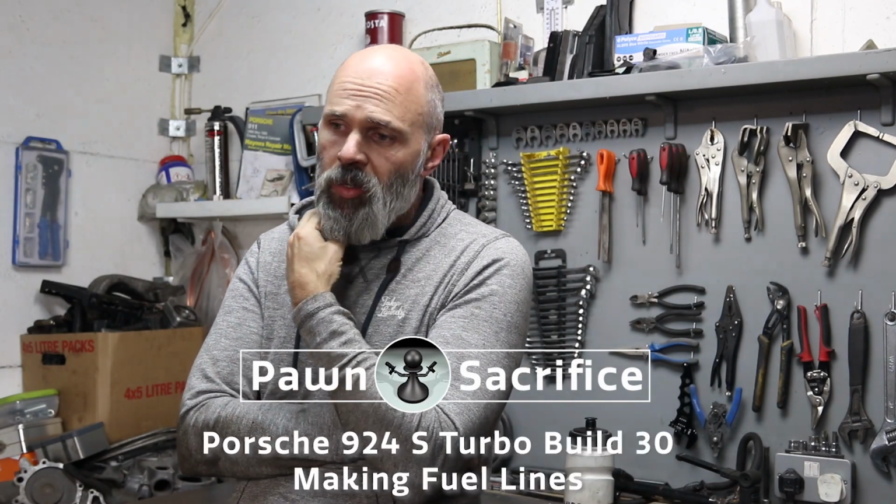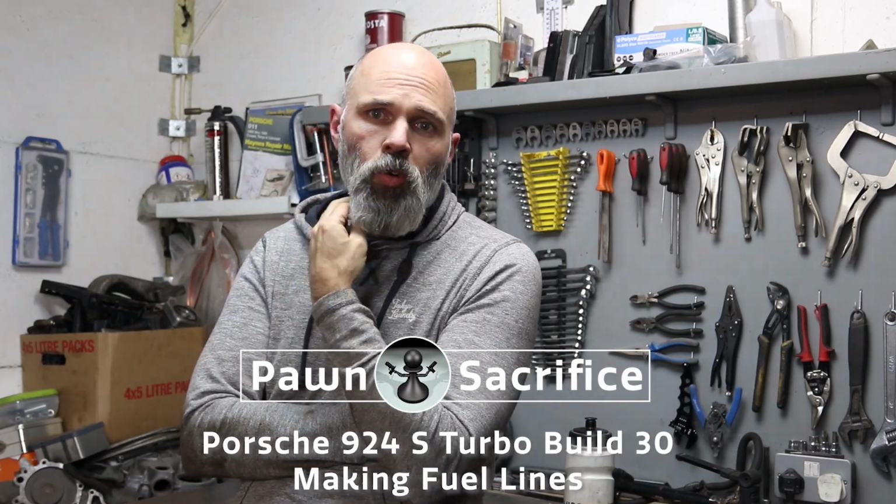This is now episode 30 of the 924S Turbo build, and today I'm addressing the fuel line situation. Essentially, the ones that are on the car are obviously for the Porsche engine, and they don't fit directly onto the fuel rail for the Audi VW 1.8T. So I need to take the existing hoses out front to back.